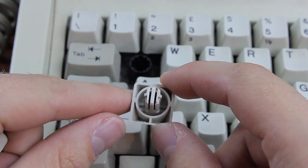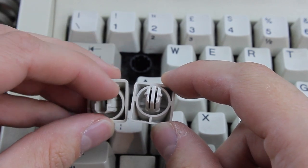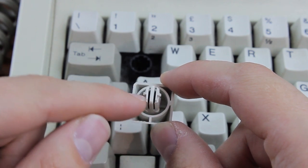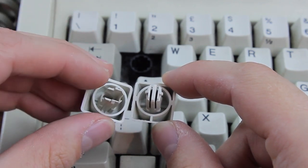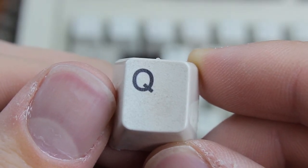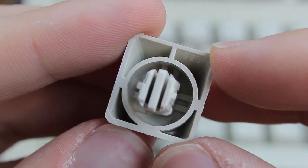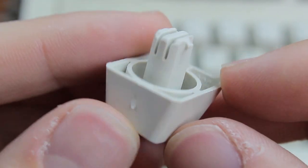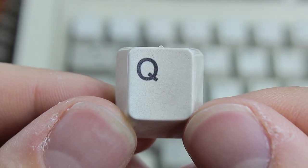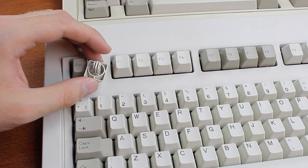Yes, the keycaps are different as well, because of course normal M keycaps have a slot for the buckling spring to slide into, but rubber domes need a pusher of some sort to push them down, so they're two-way incompatible with normal M keycaps. They are the same type though, just like the buckling spring keycaps, they're IBM's usual massive chunks of PBT with dye-sublimed printing, which means the caps don't yellow and the lettering will basically never wear off. It's expensive to make, but they're some of the best keycaps out there. They're also the older one-piece design, like on the Model F.